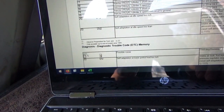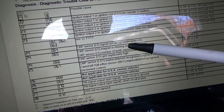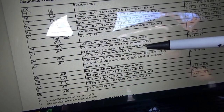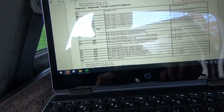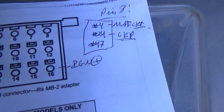Let's look up code 24. Code 24 can be any of these three: RPM implausibly high, magnet missing/segment control number of teeth implausible, or signal not recognized/implausible — CKP sensor. The customer said he replaced the sensor with something he thought would work — said it was for one model year newer — but we'll definitely need to scope the CKP pattern. Signal not recognized or implausible would definitely cause the car not to start.